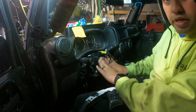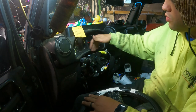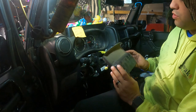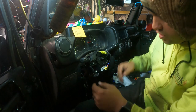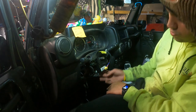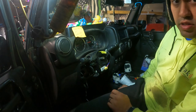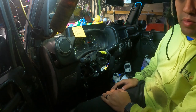Now that we have this bolted back on and everything hooked up on the three screws — one, two, three — tightened down, we need to go ahead and reinstall the actual trim pieces. That's pretty much exactly the reverse order of how they came off. We'll put this one on, put this one up, the one bottom screw in the center down here, and then the two from the bottom to the top. That'll get the trim piece back on, and then we can actually get the steering wheel and everything mounted back up.